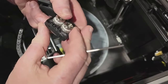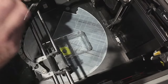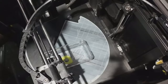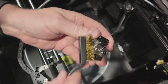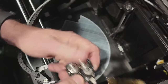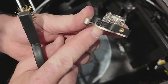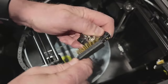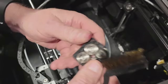It's got a bit of grime on it. I upgraded these to metal cogs because I thought they'd do a better job — they wear out less. The way to clean them is to get a wire brush and give all the cogs a bit of a scrub where the filament runs. You can turn the little screw on the side and it will turn them around for you. If you want to take them off individually, there are little allen screws in each one and they just come straight off.